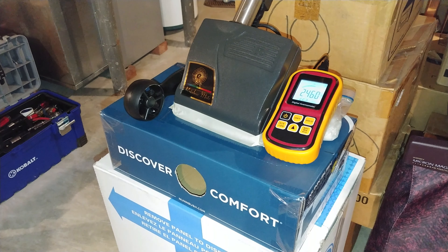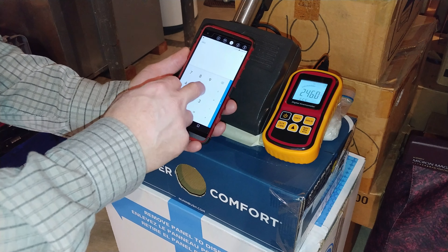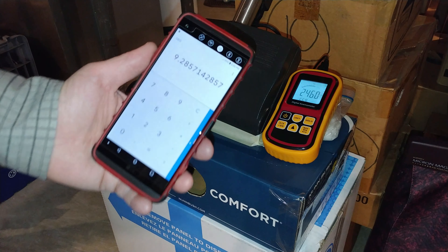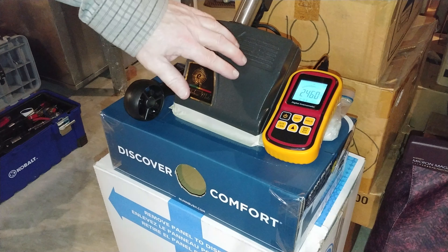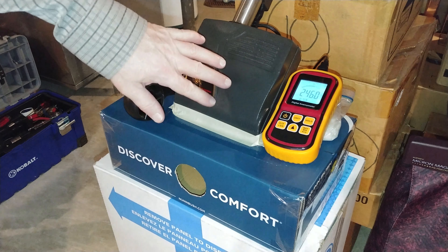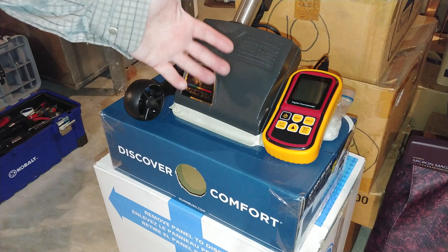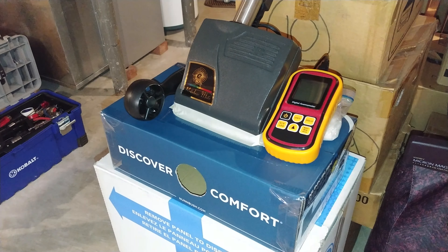Anyway, that's really, really good. If I take 65 CFM and divide that by about 7 square inches, you can see that's a CFM density like a 9, and that's way up there — this thing is going to have some pretty good cleaning. Now, the brush roll bristles in here are very, very soft, so it's definitely not going to hurt anything and it's not really going to dig. It's probably going to be great for couches, stairs, any kind of delicate surfaces, chairs, mattresses, and so on. I can't wait to start using this and making some videos of it — you should see that sometime shortly in the future. Until next time, VAC fans, happy vacuuming.